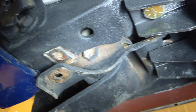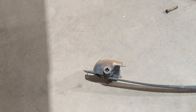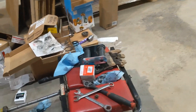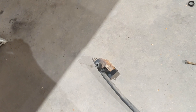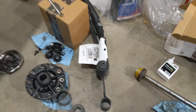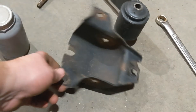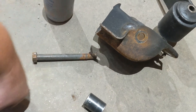Got it all out now. Just got to take that bracket off — it's just a three-quarter inch wrench. I have new shackles for the rear, so I'll put the new one on the old one since my new springs already have the front bushing in. Got it off real easy — just took a three-quarter inch, tapped it a little bit with a hammer and the bolt came right out.